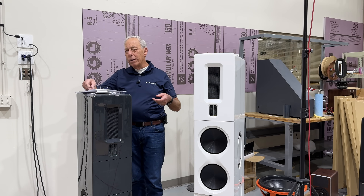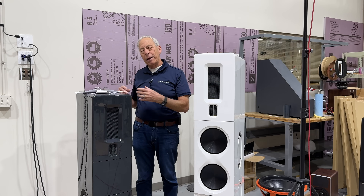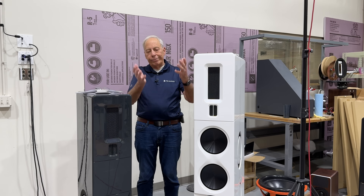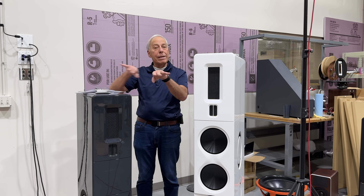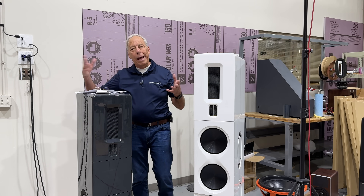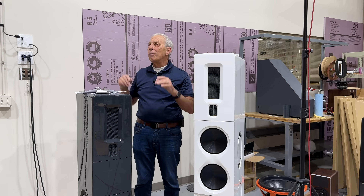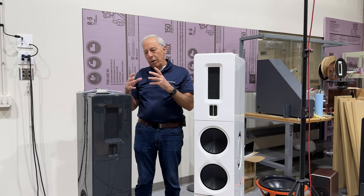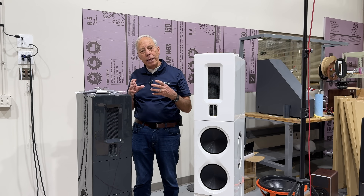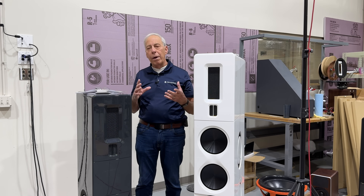Yes, that's kind of what the Air Lens does. The Air Lens is an interface between your DAC and the network, whether that network be your home network with a NAS — a hard drive that can be put onto the network and accessed from anything on the network, where you put all your songs or your downloads — or from services like Qobuz, Apple, or Tidal, any of that out there in the internet world. All of that comes in, and what we don't want to do is tie that directly into our DAC. What we'd like is some kind of galvanic isolation between the network and our DAC, which is very sensitive to noise. And that's why the Air Lens exists.